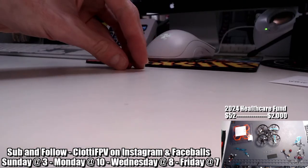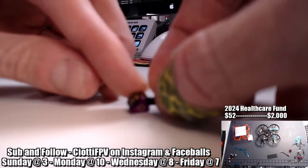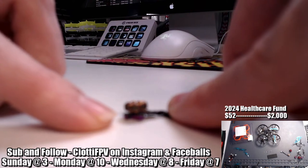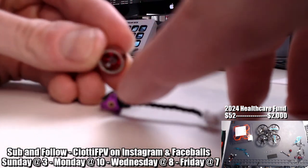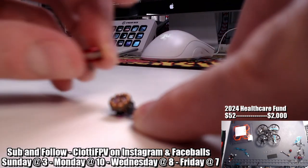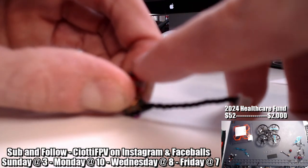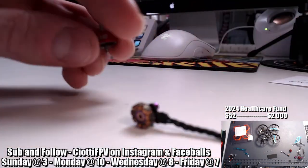It just bends the motor shaft, because, you know, picture that your stator is screwed down to a solid carbon fiber frame, right? And then the motor shaft doesn't have anywhere to go because it goes right into that bearing. So all of that force from the crashes just dumps into the top part of the motor shaft here and bends it badly.